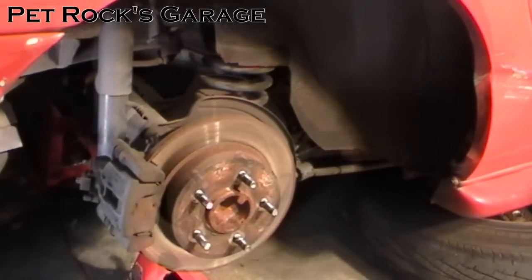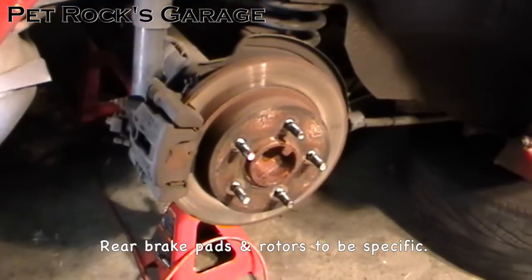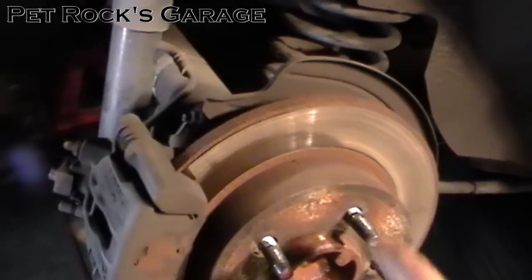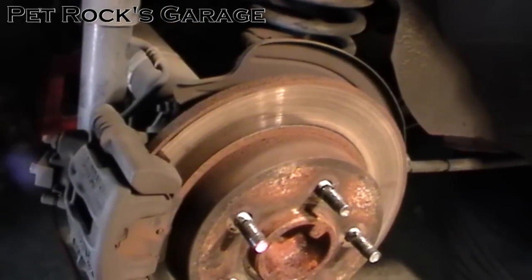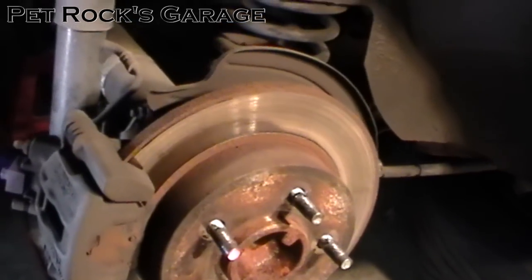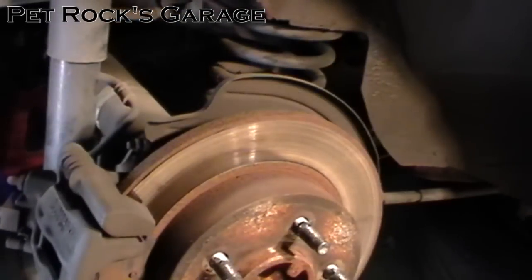This is another video by Pet Rock, and today I'm working on my wife's 98 Ford Mustang replacing the brake pads and rotor. I'm not one of those people who replaces their rotor every single time they replace their brake pads. These rotors are actually the stock rotors that came with this vehicle. I've had them turned a couple times and they've done great with no braking problems. The only reason I'm replacing them now is because I measured the thickness and it is now beyond the minimum thickness, so they're due to be replaced.